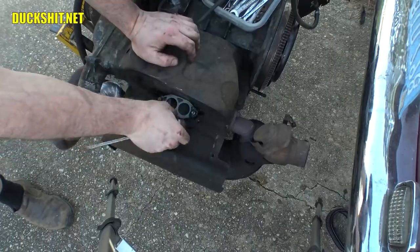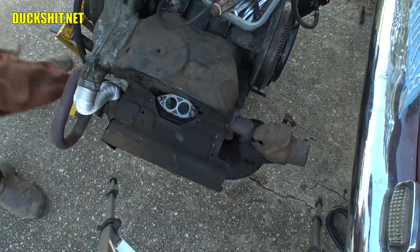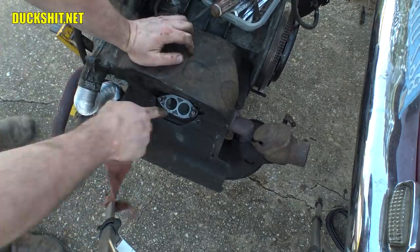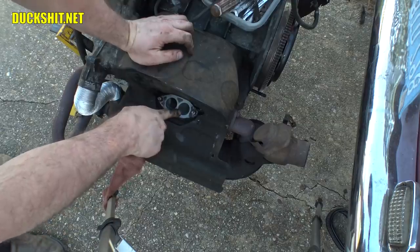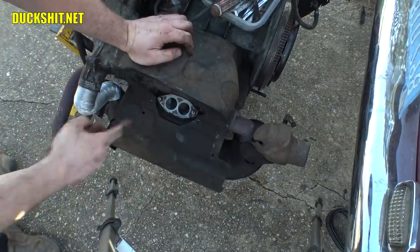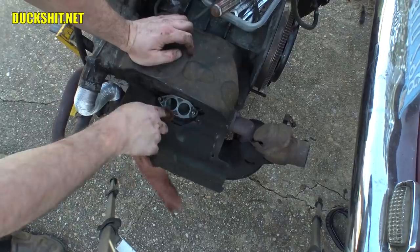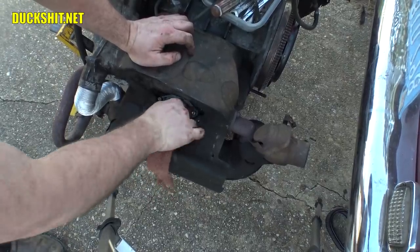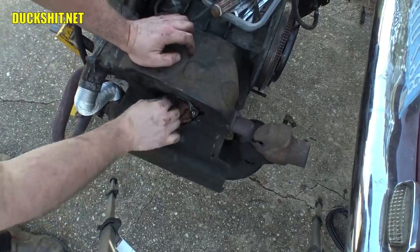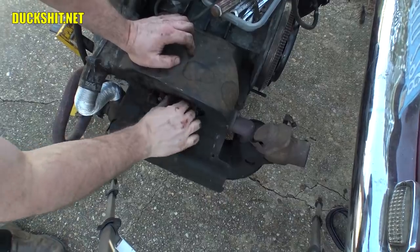And very foolishly, I did that work without dropping something down in the intake ports. One of those screws could have very easily fallen down in there. Noticing in here, these things are absolutely clean, except for a little bit of fuel spilled into them from me moving the carburetor around, but there's no soot inside of them at all, which tells me the valves are doing what they're supposed to. Nothing's hanging open. Both sides are like that. All right, good.